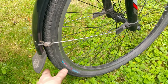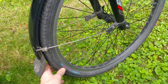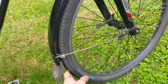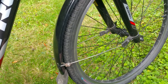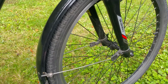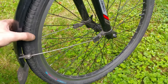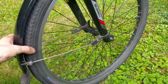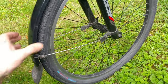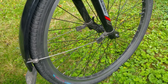I don't think I talked about my tires last time. I'm riding Kenda Comforts — they're like the 841A — they're actually cruiser tires but really nice, 1.9 inches wide. They give me decent traction for trail riding as well as good rolling resistance for commuting — kind of the best of both worlds. I also bought an actual tire gauge because my pump didn't have one, and I was way off — I thought I was running 50 PSI when I was actually running 25 to 30 PSI. These are really soft tires, so even at 30 pounds they feel stiff even though they're not.